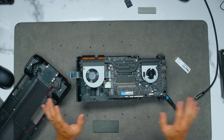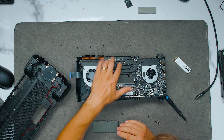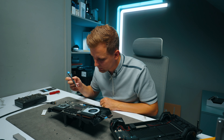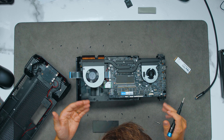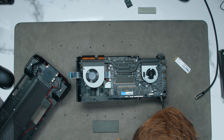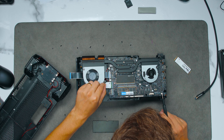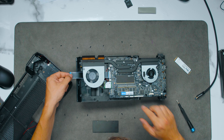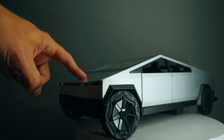I think the cooling is fine for what you're going to be doing with this PC, but you can't push more than 65 watts through it. There's a little bit of cooling for the VRMs as well. There are lots of other headers that haven't been used — some of these are usually for a display. There's another M.2 slot that's unoccupied, a fan header, and the power button is routed on the bottom and gets its signal from there. The power button is the most genius thing I have ever seen.